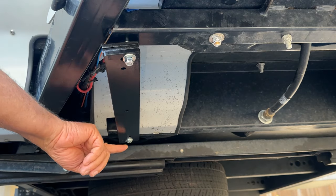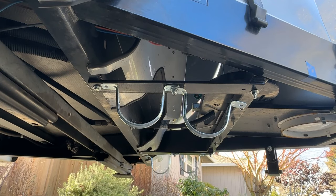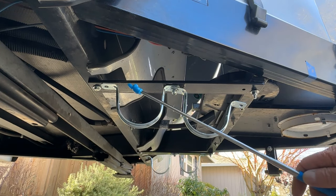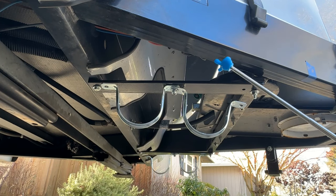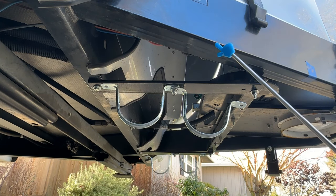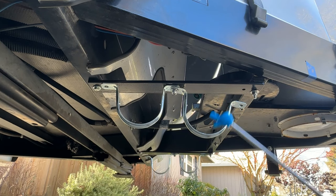My pipe straps will be right here and over here. Now you probably get an idea what I'm doing — I have my strap across here, one over there, and my pipe straps here, bolted in place with one bolt here, one here, and one here. I want to get my pipe and put it in this opening, flush at one end, then stick it out at the other and mark it to cut. I want to make sure the pipe sticks out just a little bit on the end, so I'll put it in there and see where I need to cut it.